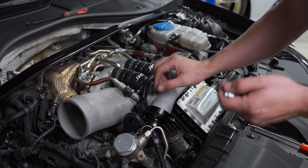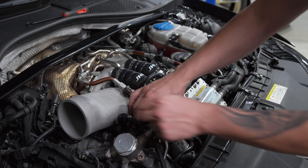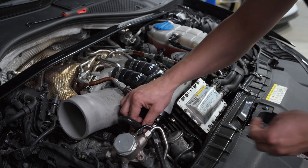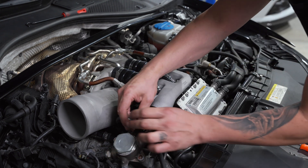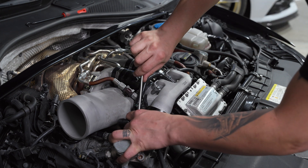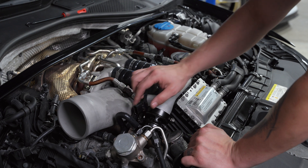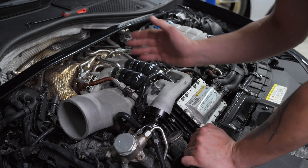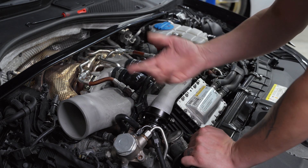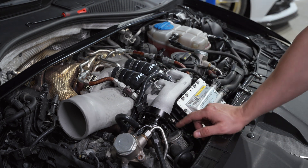After you have this installed, use the supplied clamp to attach the hose. Since it's still loose, orientate it in the best path of travel and tighten it. Clock the blow-off valve so the hose is not kinked at all — in this case it's a perfect straight elbow. Once you have the right position, take your allen and tighten it up.